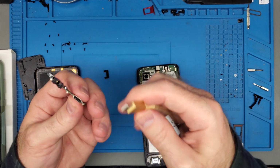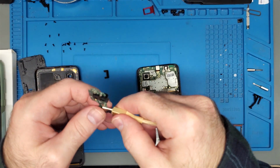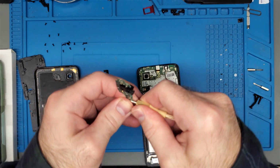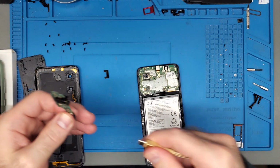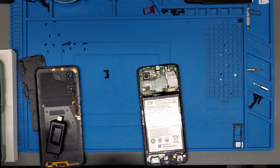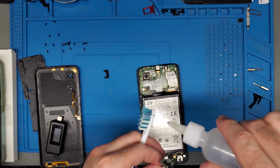I'm going to go over to the other bench and do some more testing. There's one thing that I can do immediately, just trying to clean up the pins by using pins of another cable just to charge. It's just putting it in and out rapidly to see if I can clean the pins up that way. I can also use a little bit of alcohol with a brush, maybe a good solid brush, to give that a cleaning. If that is what the issue is, I'm not really sure at this point. I'm just experimenting and seeing what's possible.